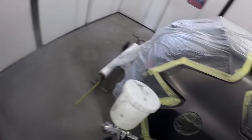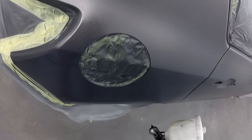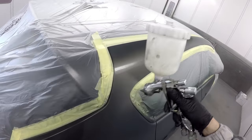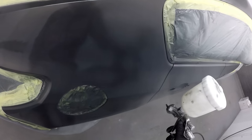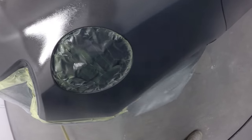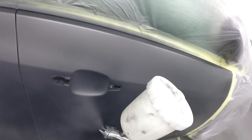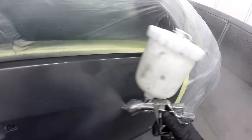On the side where I did the wing and bumper I didn't have a problem with the way it was laying down — it was just on this side of the car. This was in the height of summer, red hot in the workshop; the booth was running 25–26 degrees with the heater off, sweat coming out my glove. So all I'll do is just put a little bit of blending clear over where I'm going to put these blends. It being a really hot day I went straight over it back to back, two coats, and on a dark colour like this you're not going to notice it even edge to edge.